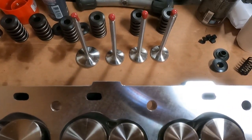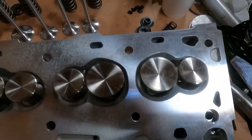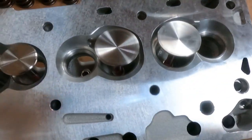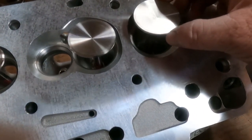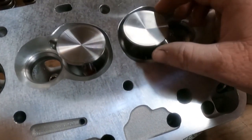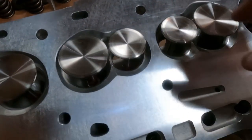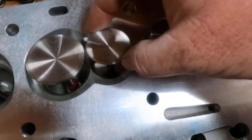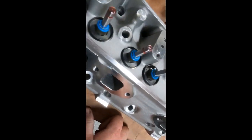We've got our valves out, cleaned them up, lubed the stems, and we're getting all of the valves installed — got a few more left to do. A little note: when we hone and ream the intakes we set them up for about 1.8 thousandths clearance, and on the exhausts we like to set them up a little looser at about 2.2 thousandths.